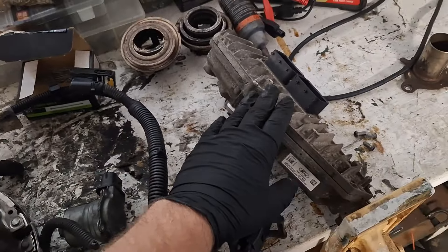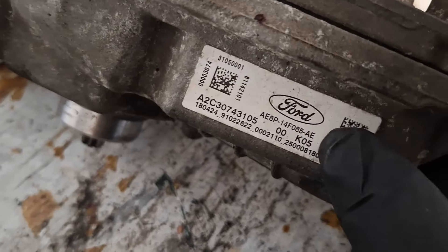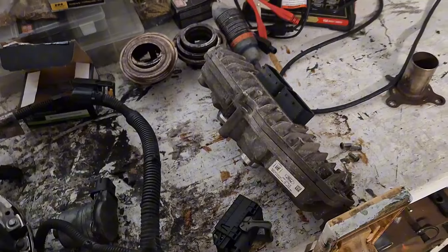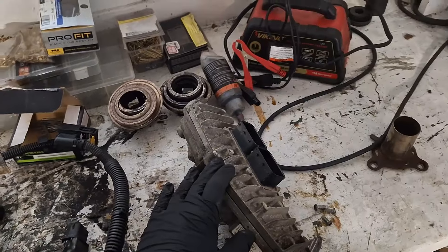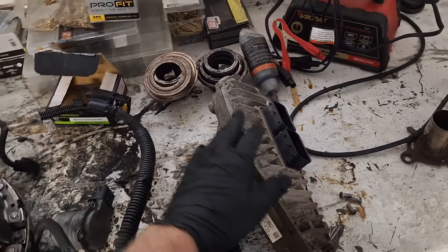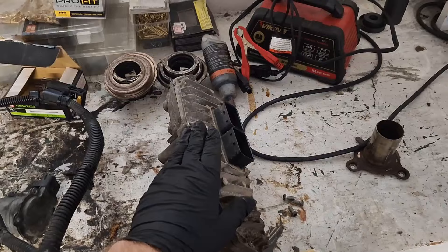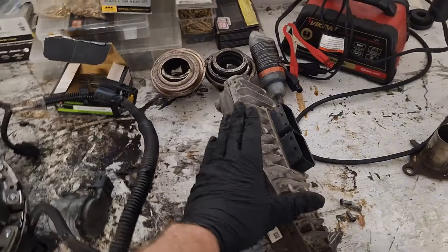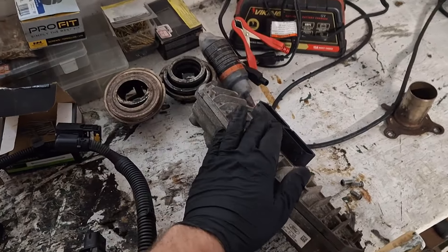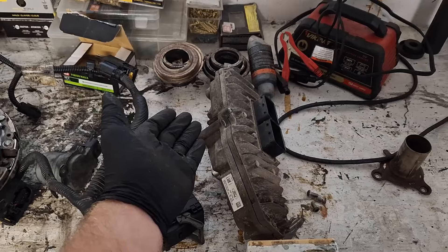I've got all sorts of videos about the TCM, so check out that playlist if you want to. K05 level TCMs — that's what this one is right here, see the K05? That means that TCM was built and programmed into a 2015 through 2018 Focus or Fiesta from the factory, so you know it has the latest and greatest hardware. Ford redesigned the TCMs around that time frame, so if there's one that says K05, you know it's built with the improved internals. There used to be all sorts of problems with these prior to 2016 or so.